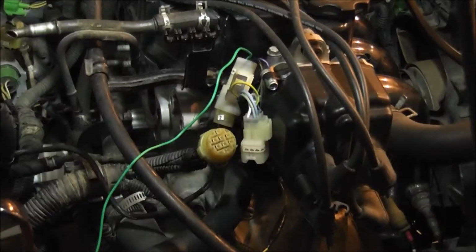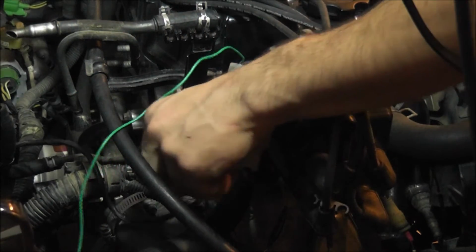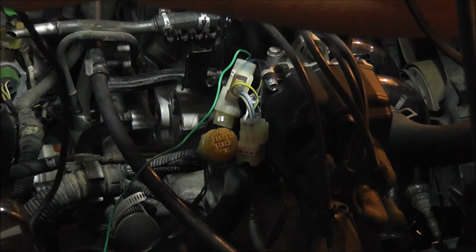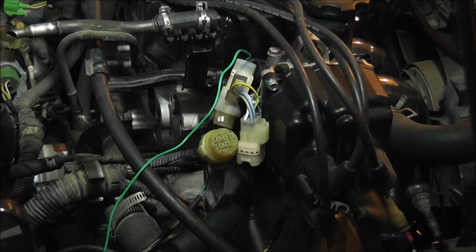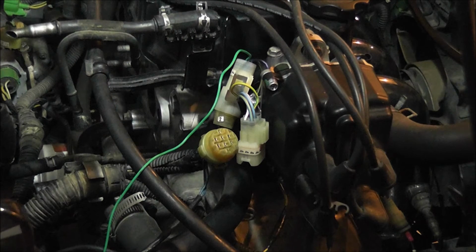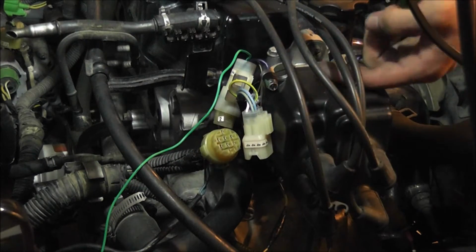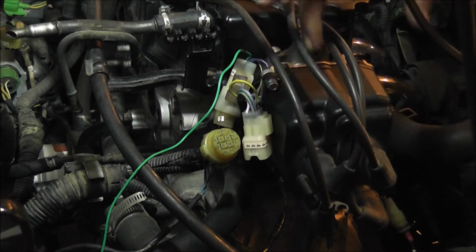But if you can get a good picture of that or whatever, I'll just put a link in the description, so that way you guys can do this at home, because it's not that hard. Once you look at that and how it's actually supposed to go down, it's not hard at all. And you could easily get it done in about a night, which is what I'm going to try and strive for. One night, MPFI swap, done. That's what this part is going to be. So now all we're left to do is remove the distributor, get the new distributor and put it on.